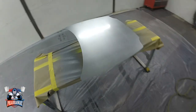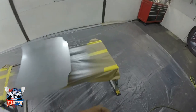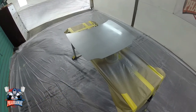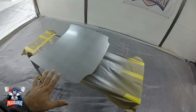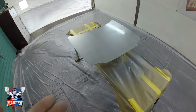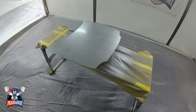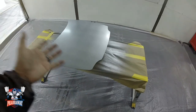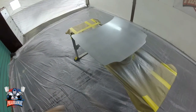I'm going to apply like two more coats. The reason I'm applying silver is because I'm applying silver metal flake. If you're going to apply a different color metal flake, it's best to get a base that's close to that color of the flake — because if the flake doesn't cover every single little thing on the panel, that base color is going to come through and it's going to be a different color. If you're not sure, paint it black and apply any color metal flake — that'll ensure you'll be able to see where it's covered. But silver is one of the best ways to do it.